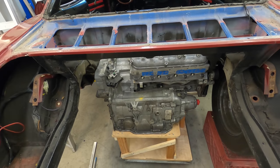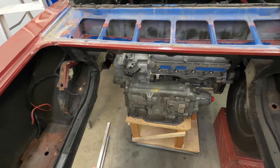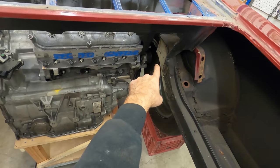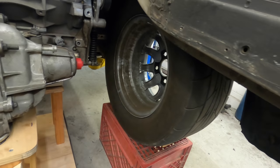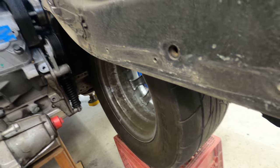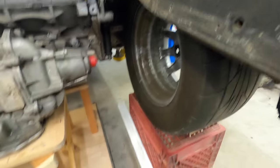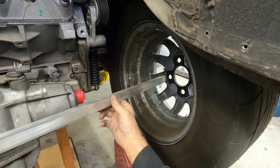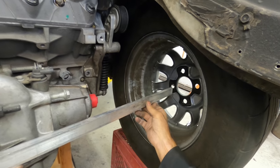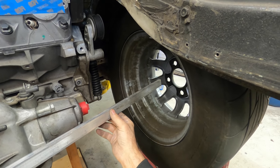What I'll be doing is starting with a roll bar and making some structure that I can tie things into, because the structure is compromised where I cut everything out. Looking underneath, the tires on my Volkswagen are 275/50-15s — I think I can actually fit a bigger tire in here, maybe 305s. Not sure yet; this is a 26-inch tire and maybe I can go to a 28. Thinking about the suspension — here's the axle shaft, and with a recessed hub or micro stub hub, I should get an axle close to a foot long, maybe 10 inches.